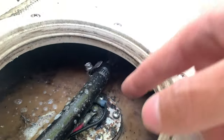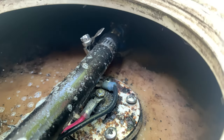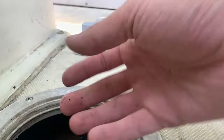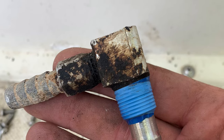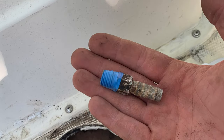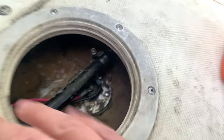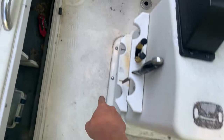Also, there's a fitting in here — I took that fitting off and put thread sealer on it. The fitting unscrews from the tank and you pull it out. I'll put pictures in the video of me putting thread sealer on it. No bubbles here and no bubbles there — this is as tight as it could get, so this is done.